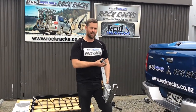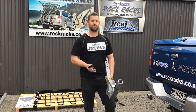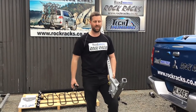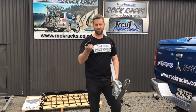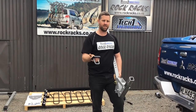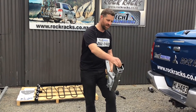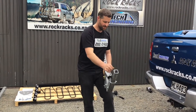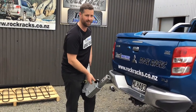We've got our rack, mast, base and hitch all ready to go. The rack comes already bolted together as you see here. It also comes with a plate and U-bolt hitch lock assembly — I've just pre-bolted it together ready to go. It's easier to slip that over before you put the rack in. Then it's just a case of putting the rack into your hitch receiver.